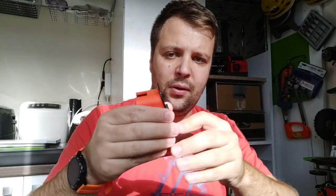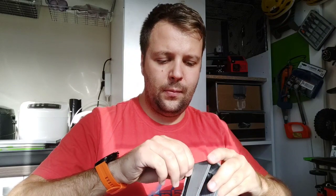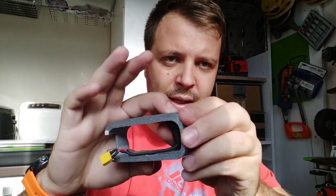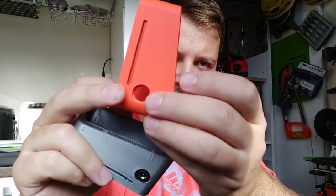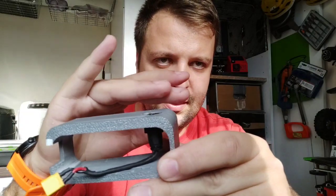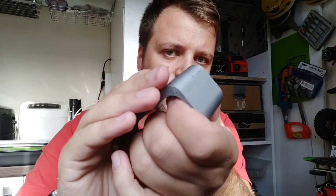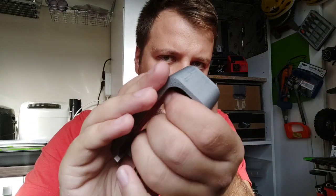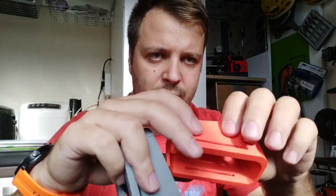If I want to extract the battery, I have this here, and I can pull the battery. Here I have the charger port. It is mounted on the same concept: in the STL part, the outer diameter is bigger than the inside, so the port will not get out, it sits on the same flat position. You have the same plastic nut that you can tighten to fix the charger port. You have about 4 millimeters inside, so it's pretty strong. I can break this one if I want, but I really need to force it.